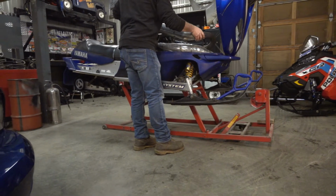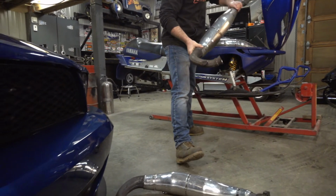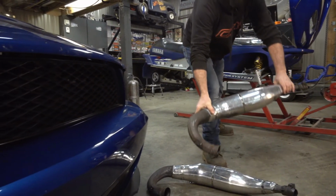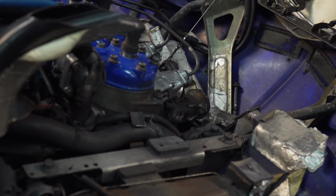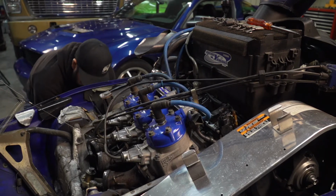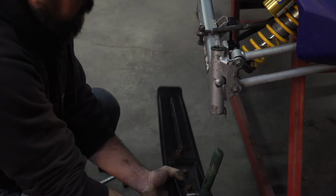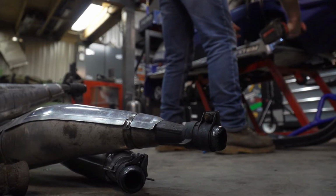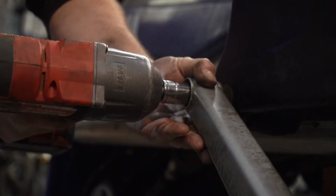The suspension has a bunch of bushings and rod ends that over time all wear just a little bit, but taken together, all these little areas of wear can add up to a pretty loose suspension. On the ground, you never notice with the sled just sitting there, but as the suspension loads and unloads going down the trail or through the corners, this wear can start to work against you, creating a very darty, unpredictable feeling snowmobile. On this sled, there's nothing that's really broken or about to fail, just worn out a little bit, and I want to tighten up the feel of the chassis.